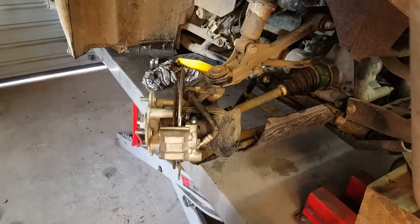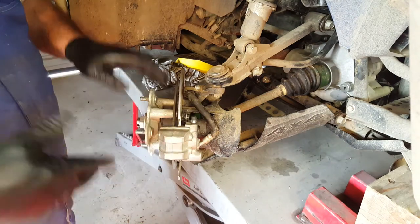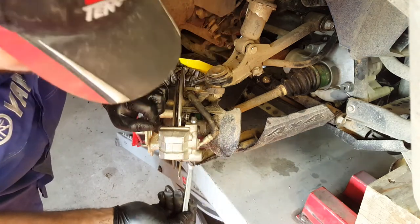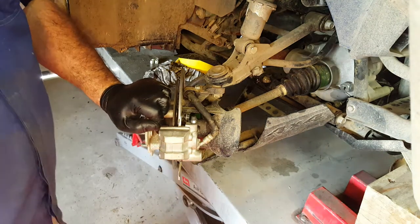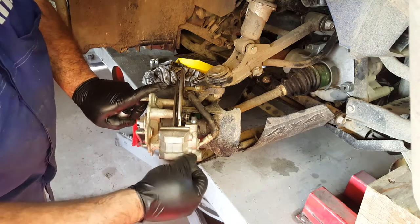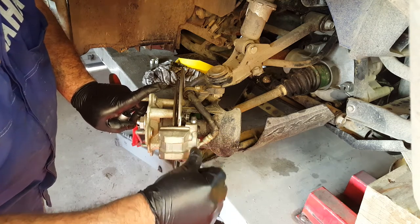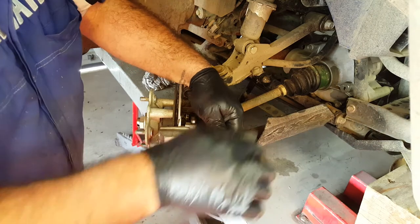I'll also cover the things you need to look for that can be problems. So we've taken the front wheels off. This is the rider's side front caliper, retained by two 12mm M8 bolts — one at the top and one at the bottom. It's normally tempting to undo those first, but before we do that we've got quite a bit more to do. We're going to take the pads out, which means we need to remove the pad retaining bolts — two 5mm Allen key bolts that run along here with threads into the caliper body — and they're often pretty tough to undo.